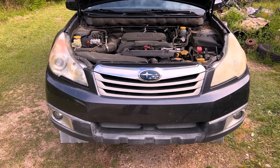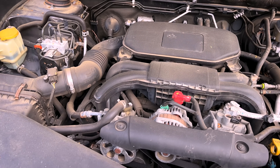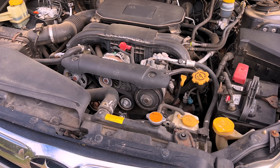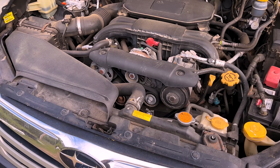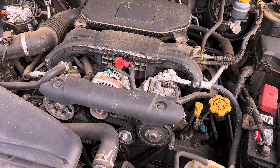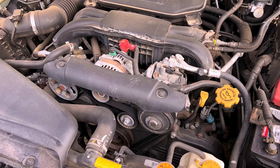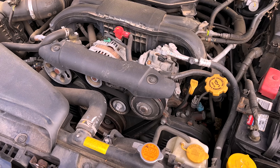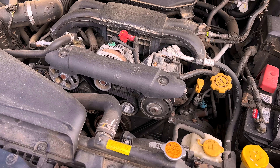Greetings viewers, welcome back to the channel. In today's video we are back on the 2010 Outback — we've covered this car extensively in the last few weeks. Today they brought the car back for a timing belt and water pump replacement. The car is about 176,000 miles and we do not know the age of the timing belt. They bought it just past 100,000 miles, maybe 110, so we don't know if the timing belt has ever been replaced. We're going to preemptively do it — it might be a little early if it was done on time, but rather be safe than sorry with the timing belt on the EJ series engine. It would be better to change it early and know you're safe than wait and have it potentially break, destroy the engine, and bend all the valves. So let's tear into this car and get the new timing belt and water pump kit installed.